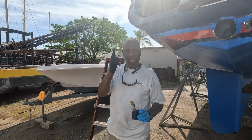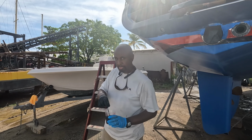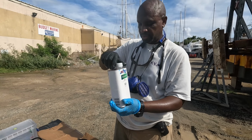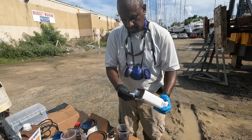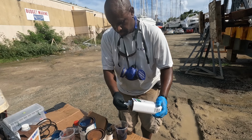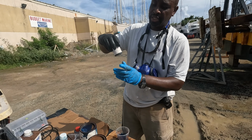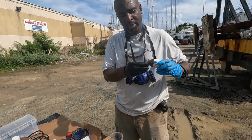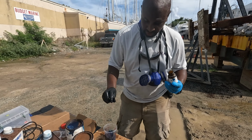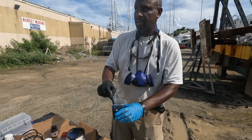So Julian and Kylie, my subscribers, this one is for you. Just pay attention to how I apply the paint using the roller. Okay, it's been 15 minutes, and now I'm gonna add the T0031 reducer, brush reducer. Because of the weather, I'm not gonna take any chances. I'm gonna add a little accelerator in here, just about 2 drops. Yeah, the weather has not been cooperative, so I'm not taking the chance, and I'm ready to paint.